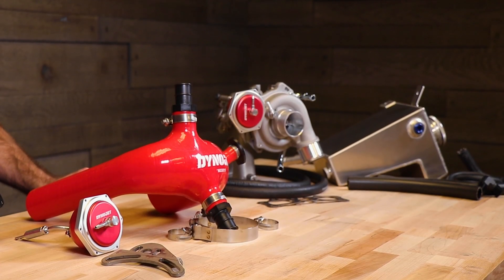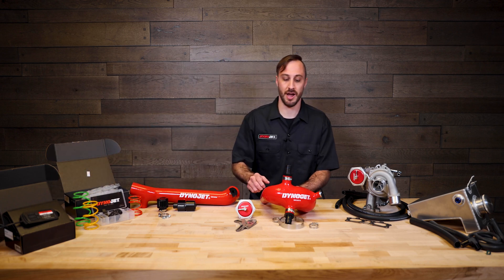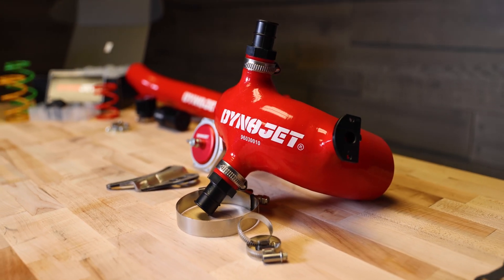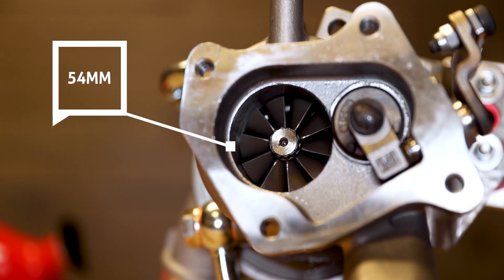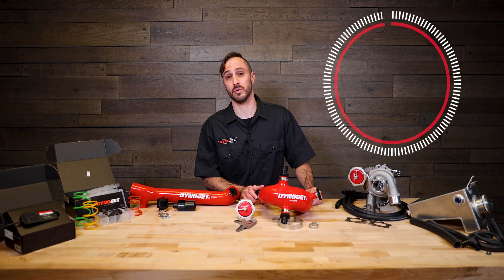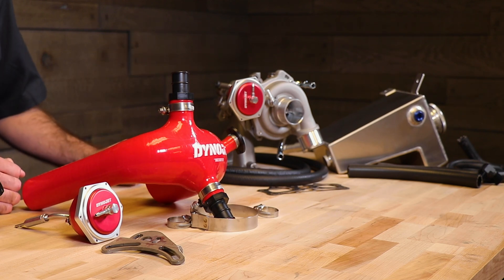Now if you race or you're looking to dramatically increase the power out of your Razor, maybe stage four is more of an option. Stage four is going to include the PV3, clutch kit, and boost tube. We're going to replace the factory J-tube with our silicone design, giving you more durability for the increased boost pressures the upgraded turbo system brings. This turbo system has a larger compression wheel and a larger turbine wheel, which can boost pressures up to 21 PSI — correlating to horsepower gains of up to 40 over stock to the wheel. If you're looking at stage four and want to guarantee the turbo system is running as efficiently as possible, you're going to get stage five.